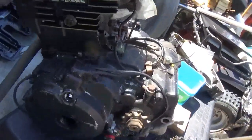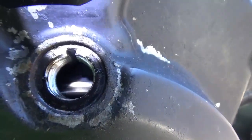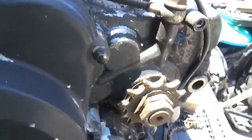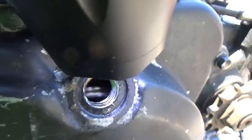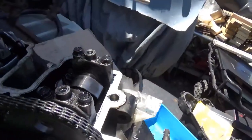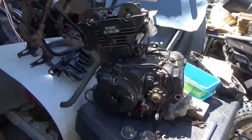It's very important that your valves are closed because you don't want to mess around with your valves open — if you jump time, the piston comes up, smashes the valves — bad day. I'm hoping you're able to see that little 'T' there on the flywheel. I know I'm at top dead center, the piston's all the way up. You can also put something soft in the spark plug hole and dial it so the piston is all the way up. You look in the book, you got one little divot there and one little divot there — so you're at top dead center and the engine is safe to work on.